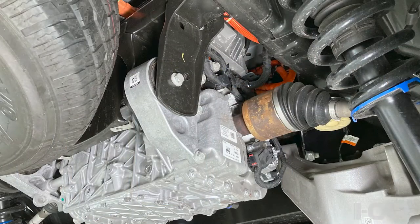So if I did rear suspension work or had to replace that sensor for some reason, is there anything special I need to think about? After any of the sensors have been disconnected from the control arm, say you were hitting the rear there and you need to replace that control arm, you would have to go through FDRS and run the ride height calibration on it. Pretty straightforward otherwise, yeah.